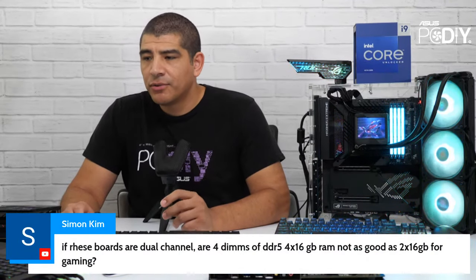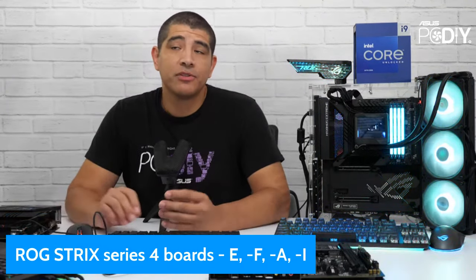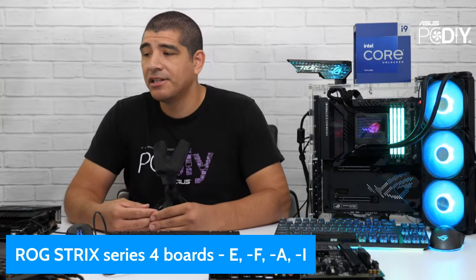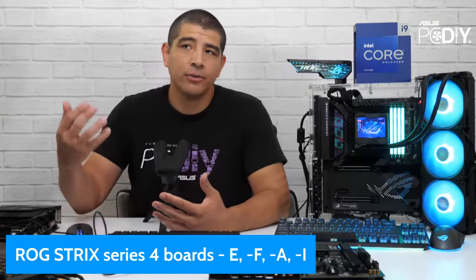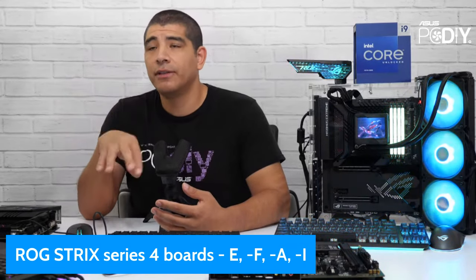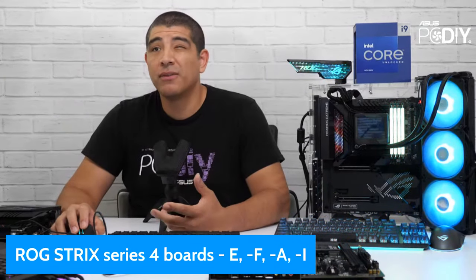If these boards are dual channel, are four DIMMs of DDR5 not as good as two? So for gaming, don't run four DIMMs. There's no point. You really only want to run two DIMMs, because two DIMMs is going to give you also the highest DRAM scaling, and it's also going to be less demanding on the memory controller. We have actually a great video that we did with our friends at Kingston, as well as our friends at Crucial, on DDR5 that you can watch here on the channel, or you can join our PCDIY group linked in the description, where we do a DDR5 insights post to give you more insight.